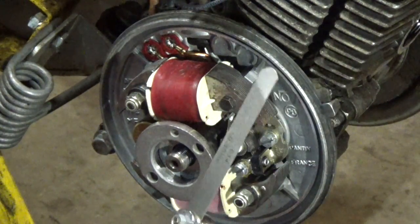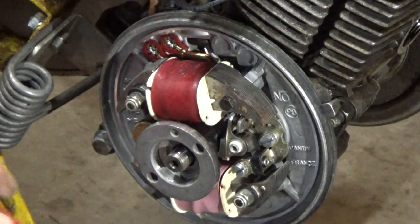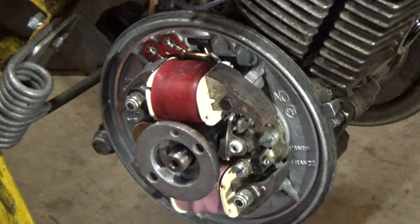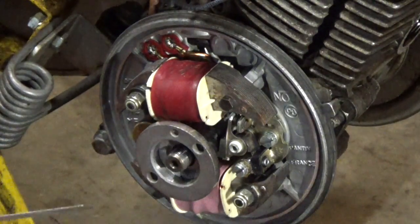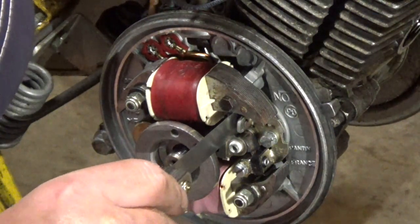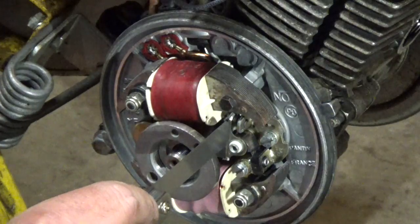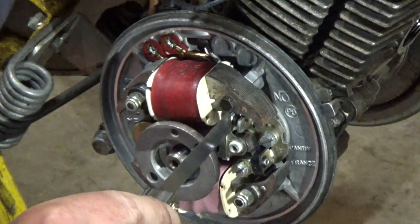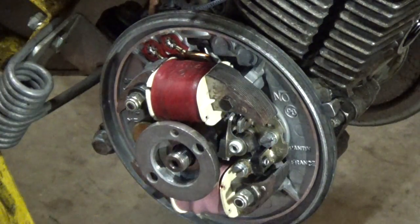.35 and make sure that there's no oil or anything nasty on that. Clean it off really, really well. Suck to clean the points and then dirty them up with a nasty feeler gauge. What you're looking for, just a touch of drag on it. These ones actually feel, dare I say, perfect. They feel absolutely perfect. Okay.